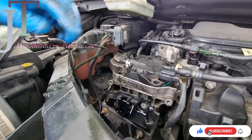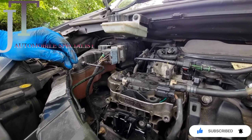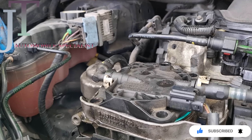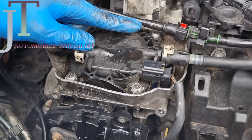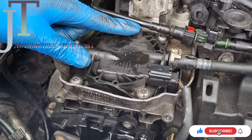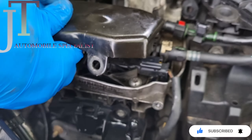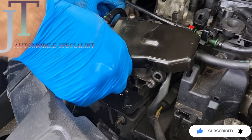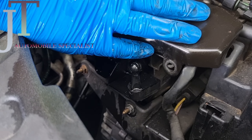In these cars they do not have an electric fuel pump back in the tank, so you need to bleed the air from the fuel system. Remove the outlet pipe and add a hand pump or an electric pump to bleed the air. Make sure you bleed the air, otherwise your car will be air-locked and you will not be able to start the car again.